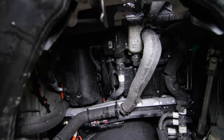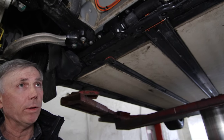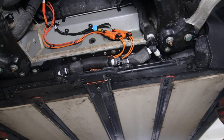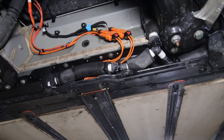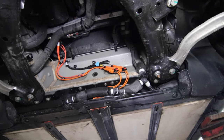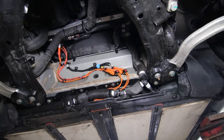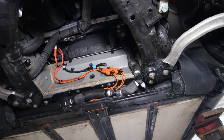That helps you when you're warming the car up. But when you've actually set off down the road, then you no longer have that feature. And the car is now depending on just the normal battery warming to heat it up. So for most people, if you have the reduced regen dots that show up on your energy bar, which most of us do, yeah, if you have those when you leave the house, unless you have a very long commute like I do, chances are you'll still have those regen dots by the time you get to wherever you're going. Yeah. So that helps in this capacity. It just makes it a lot easier for the car to warm itself up to its normal operating temperature. And then it also doesn't cool down quite as fast.